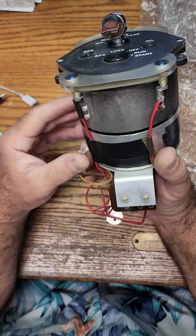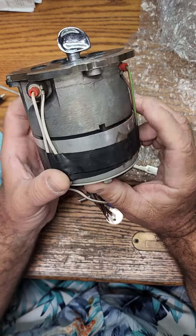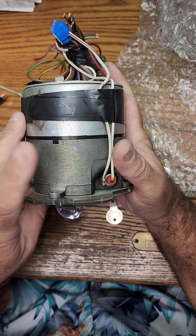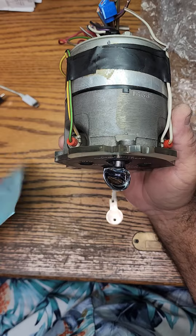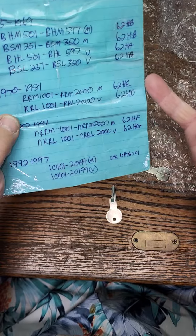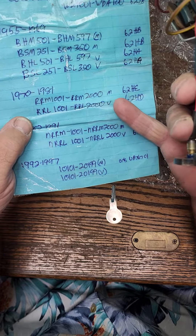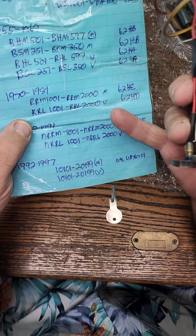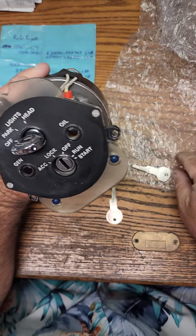To make one of these from a '79 Rolls-Royce Silver Shadow, look at the cover here. You can see a partial number — it's 1633. That would be the partial key code for this lock. And by using my little chart here, the chart tells you for '70 to '81 you're going to use a 62 HE or HD, which was an RRM 1001 to 22,000 for the master. RRL is the valet key, 62 HD. And we went ahead and made the key.